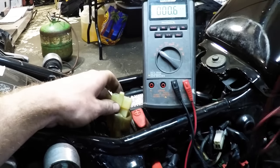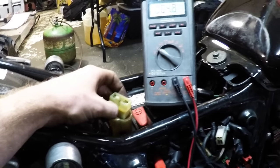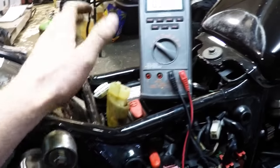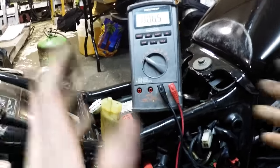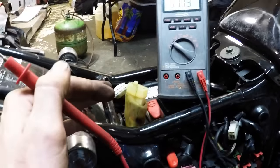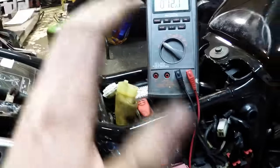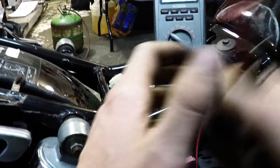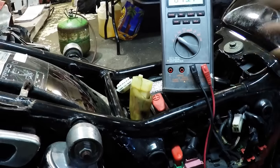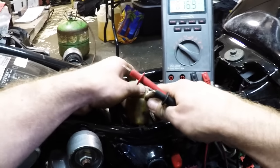If you have breaks in that black wire or breaks in the red and white wire, you could have charging system issues — possibly no charging, possibly low charging, or it could be over-charging. This bike in particular has a very wide range from 13 volts to 16 volts of charging; if it's over 16 volts, there's something wrong with the regulator. Bikes vary with what they want the cutoff to be, but this type of system is very widely used in all mid-range to high-RPM style bikes.